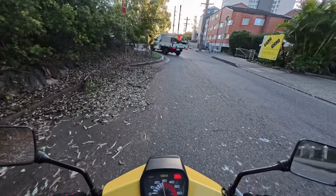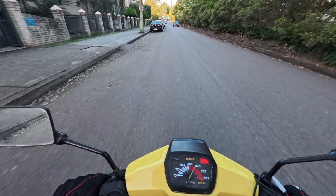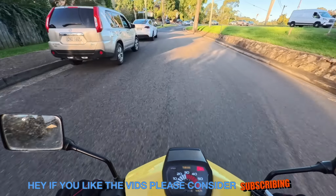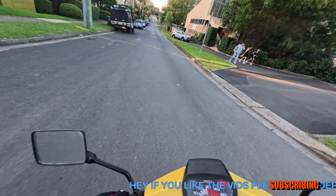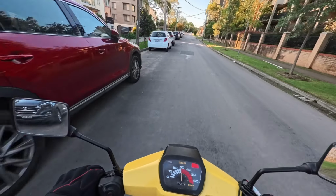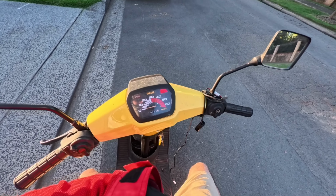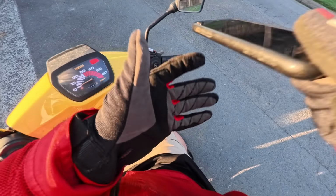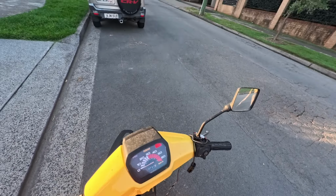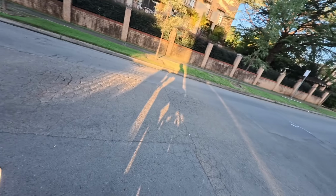Interesting. I'll go back again. See what speed we can get. This thing rips. This thing goes really good. Wow, man, that is awesome. That is insane. What was the top speed then? I may have just jagged it first go with the carb settings. So that's 67 kilometers an hour just in that little area there. And we're still at 259, so we're not too lean.